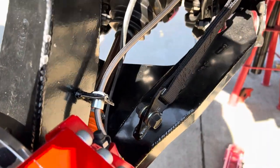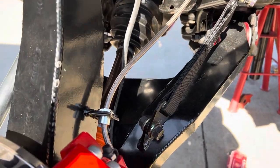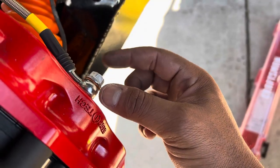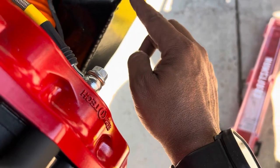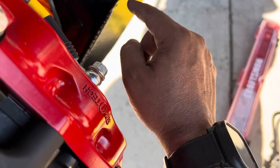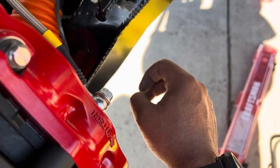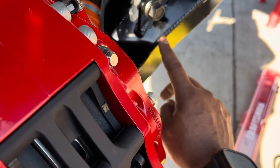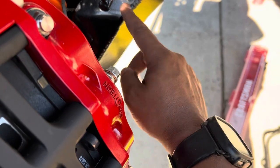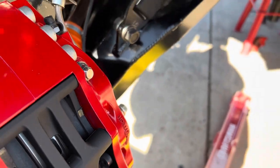I'm gonna cycle the suspension to see about where it's at its longest and see how it does, and then I'm also gonna turn it to make sure this clears. I don't think it's going to clear — we'll see where it stops and then I might just take a notch out, make a mark, take a notch out, and then call it good. If I notch it too much and get a hole I'll just burn it in and seal up the hole.